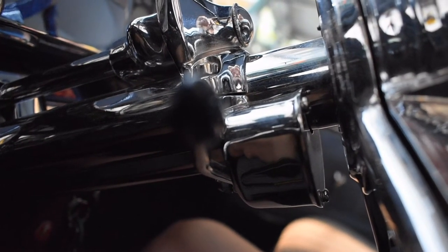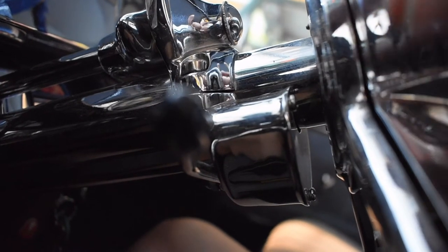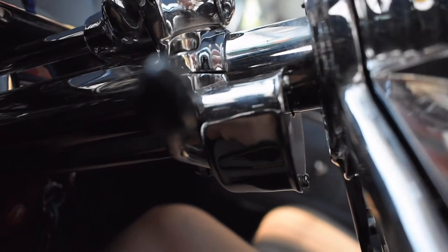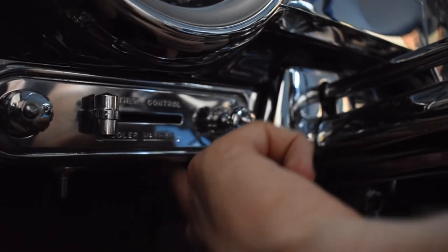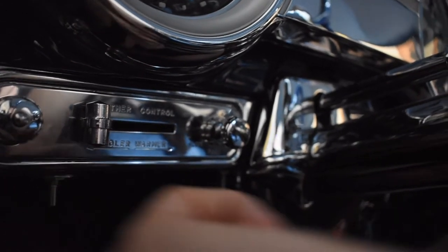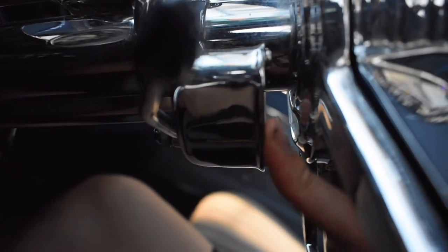What was happening is the power for the stop lights goes down to the brake light switch on the master cylinder — it's a hydraulic switch, power in, power out. It comes back up, goes under the dash, through the firewall, under the dash again, into a bus behind this control pod. Inside that bus, it splits into wires that travel up into the turn signal stalk switch in this big housing.